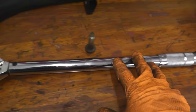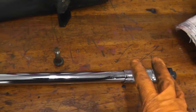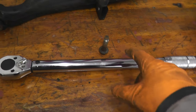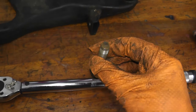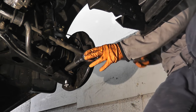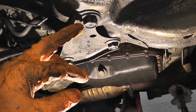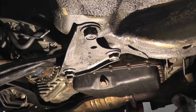Now we're ready to use the torque wrench. If you've never used one before, I have a separate video on how to dial these in. You can typically rent one from your local auto parts store or purchase one for around $30 to $40 — I'll have a link in the description below. The pinch bolt has to be torqued to 40 foot-pounds. Once the torque wrench clicks, you know you're at the right torque for the fastener. For the support plate, the fasteners attaching to the body are 111 foot-pounds, and the fastener connecting to the lower control arm is 81 foot-pounds.